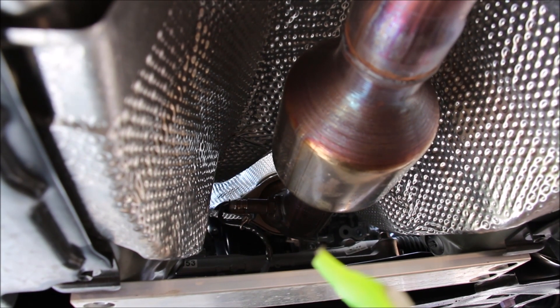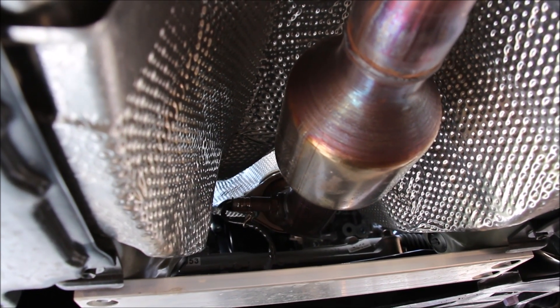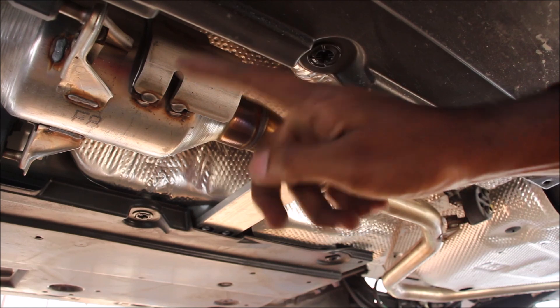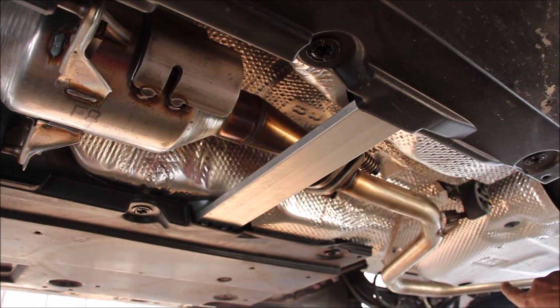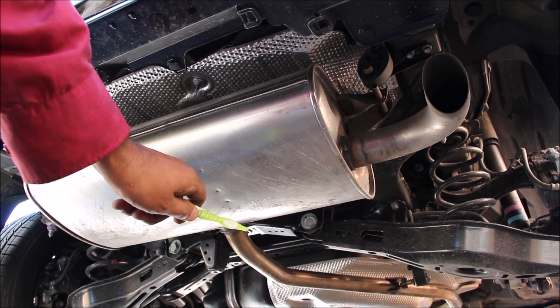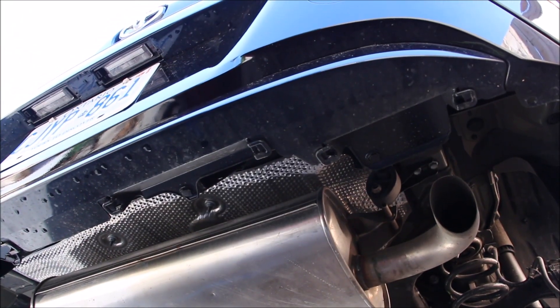The exhaust system is fairly straightforward. After the header and the first catalytic converter we have an O2 sensor. The exhaust then flows through the secondary catalytic converter, then through a mid silencer, and out to the tailpipe to the muffler. The muffler has a single center inlet and a single outlet on the right side that exits below the bumper, so you can't see it from behind the vehicle.